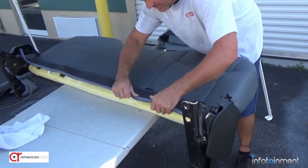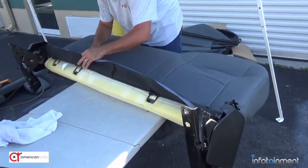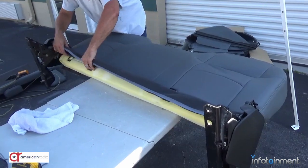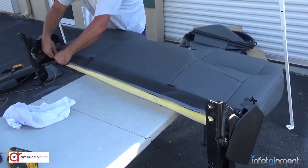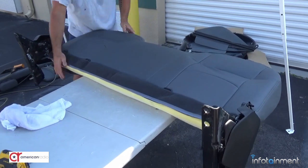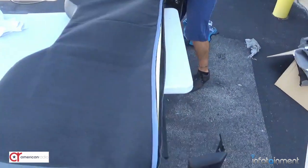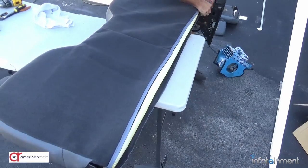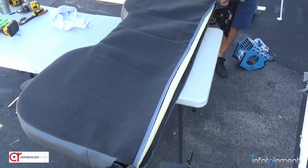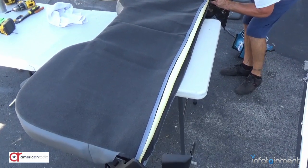We're tucking around for the child tethers. If you don't do it before, tuck in your little side pin. I'm gonna flip it over and zip. This is the hardest part, but luckily the carpet stretches a little. This is very easy to bust zippers on this. If people can't get it and they're fighting it and just trying to use the zipper as the pull part, now pull it all together.